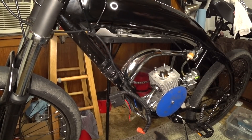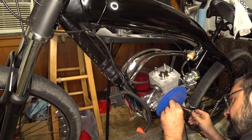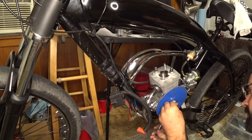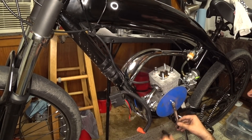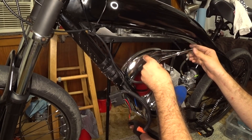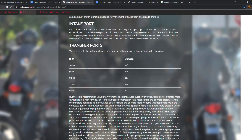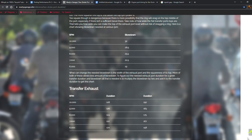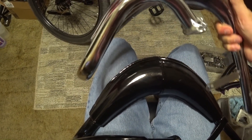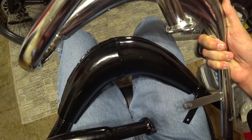On to the ports. As I begin to make modifications that are greatly impacted by certain aspects of the motor's design, I'll be sure to cover them in detail to the best of my knowledge. What you are about to hear is an oversimplification of a two-stroke, but in general longer port duration will move the motor's RPM limit higher. If left unchecked this will sacrifice low RPM power, but there are a few tricks the community has found to help lessen the sacrifice. You will also see later in the episode that without a decent pipe it will be more difficult for this small displacement motor to have enough power to even reach higher RPMs.